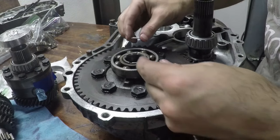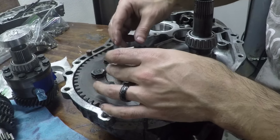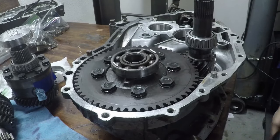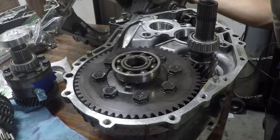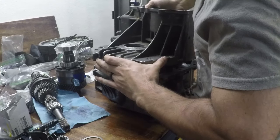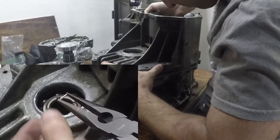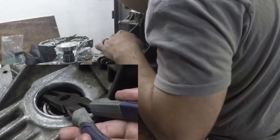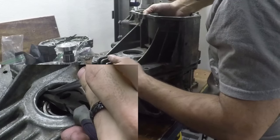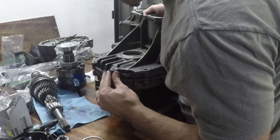So we just go ahead and push them in. Now we can try and balance these sections of solder onto the bearings — tediously spin them in just the right place, but as soon as you bump it the whole thing falls over. What I ended up doing later on was playing a little bit more of a game like Operation, where I used some needle nose pliers and just tucked them in using a flat head to help push them on. This was a lot easier — way less time, way less effort. If your seals are already installed and you don't want to pop them out, you can do it the other way too.